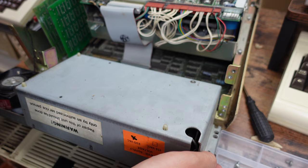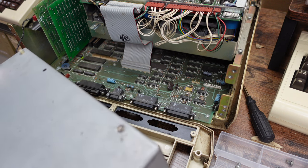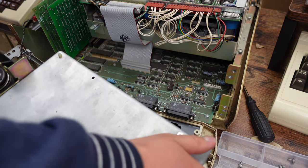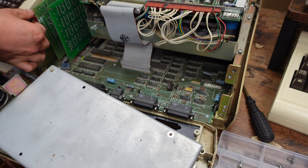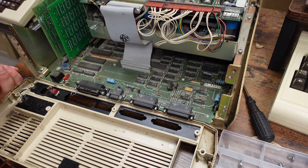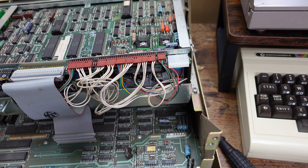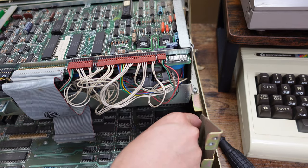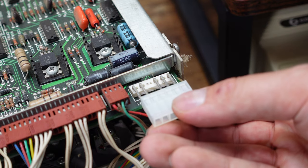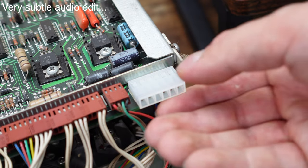Coming to issue 2: when I took out the power supply I immediately wondered how it powers the computer. I could see the power connector on the board. At first I thought it might be a card edge connector, but no — there's no cable in this machine to connect the power supply to the motherboard and disk drive controller. This is not a great sign, as someone has been in here before, which could mean it is faulty. This will require a cable to be made, which I've not done before. I have some Molex connectors I could use, but it turns out the pins I got are incompatible with the housings.